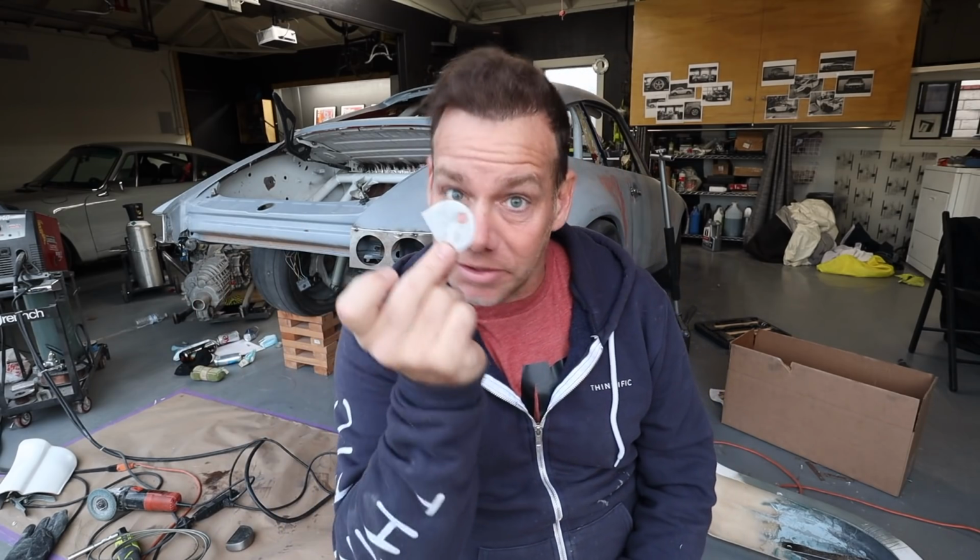So I've got the passenger side super dialed. It looks great. I'm really happy with how it turned out. I've got to duplicate the entire thing on the driver's side. I've got to weld this little tab on. I've got to drill the holes to mount the bumper. I've got to cut the relief cuts in the bumper. At that point, I can mount the fiberglass flared end and then strap it together before I fiberglass the inside.